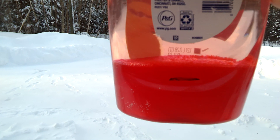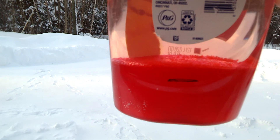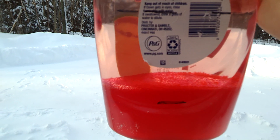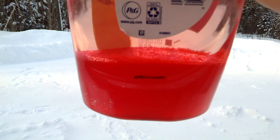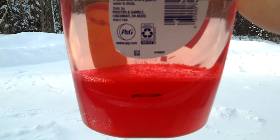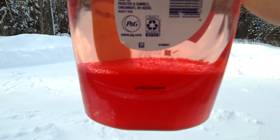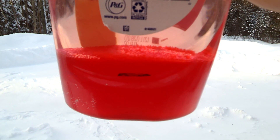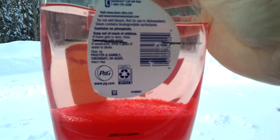You see the black line was where the original line was with the ethanol. What I did was I put some red dye in there, let it sit, shook it up, and the water absorbs the ethanol and sinks to the bottom. So clearly I have more water in there now because it's combined with the ethanol. I don't know if it's 10% or 15%, whatever it is, it's more, so it works, and the gas is on top here.